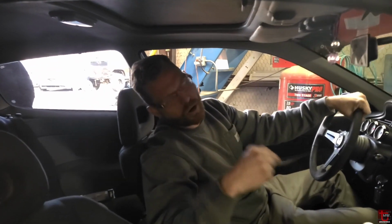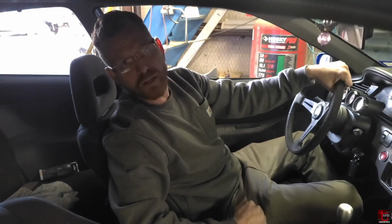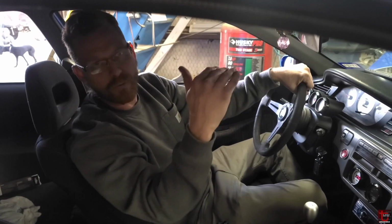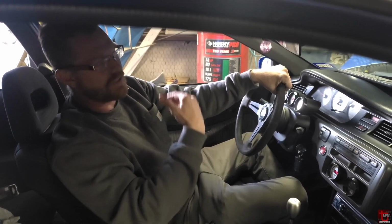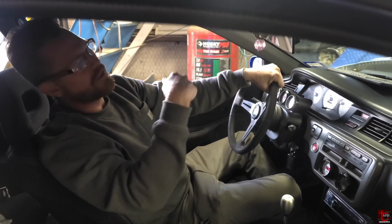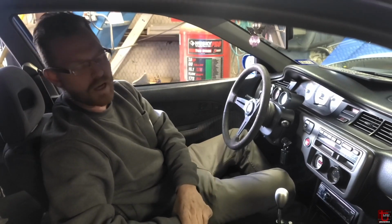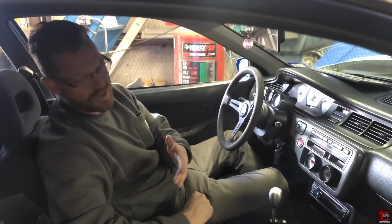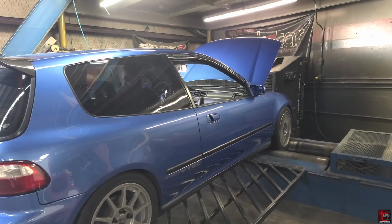My previous point, I added 10% there, and that wasn't enough. So I'm going to bump it another 5, maybe even another 10%. In this case, it looks like 20% might be the bump that it wants, because the VE changes that much. He does have a lot of nice parts: the intake manifold, the throttle body, and the turbo. All of his parts stress high RPM power. So it makes sense that we're having to add in more and more. I'm going to do that now, and then hopefully we can make a complete pass through VTEC.